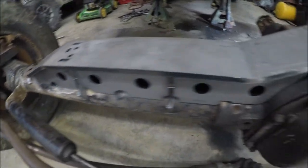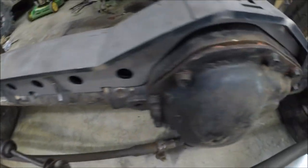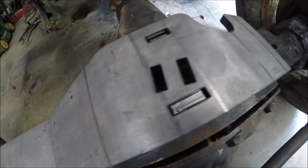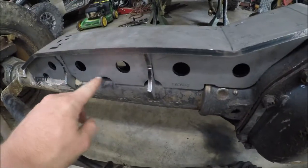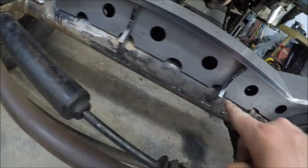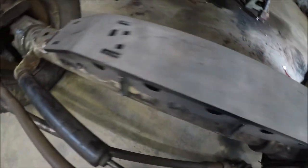I got the truss sitting about where it needs to be. They even have a cut out where your breather hose is. They make this top part so this top piece can pull up, and they've got little spots here where I'm going to go ahead and tack those areas. I think the reason they make this top piece removable is so after you get these bottom pieces welded, you can pull this up and get inside of it. But I don't really see any reason to weld the inside — I believe welding the outside of these should be strong enough, so I'm going to go ahead and tack those areas.